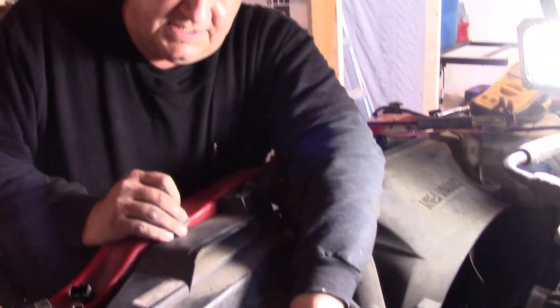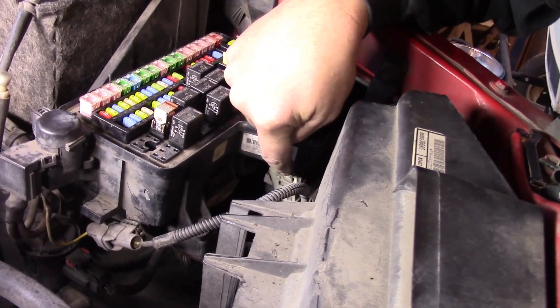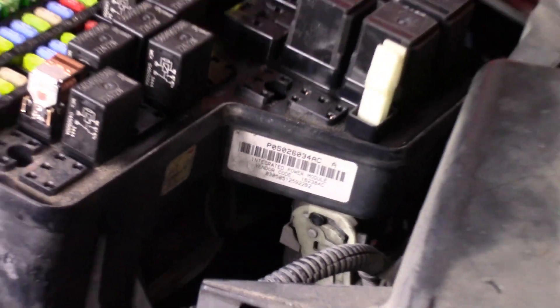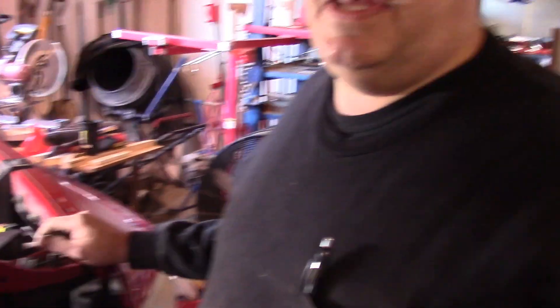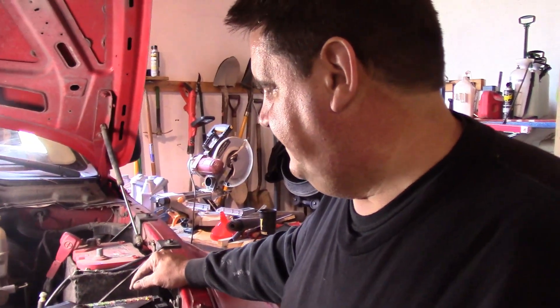I would recommend you get something like an AllData subscription. You can go to AllDataDIY.com and get a subscription for your vehicle if you really want to do it yourself. Different vehicles may be wired differently. This connector right up here underneath the box — this connector right here — is the one where that pin goes to. So if you use your multimeter set on continuity, you should get a beep on one of those pins. The pin on this one is called K-51. It'll show you in an exploded-view diagram. I've already got this box mounted back in here, which is a pain in the butt, so I'm just gonna have to take my word for it on that. And it wasn't the problem with this truck anyway, but I am gonna show you what was the problem.